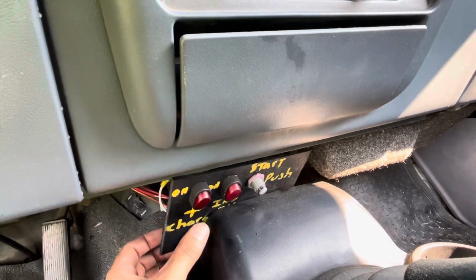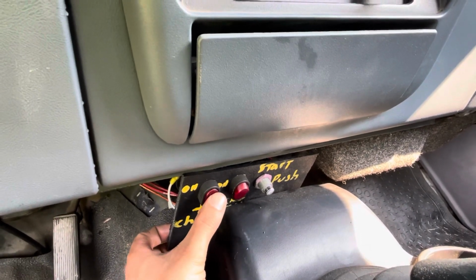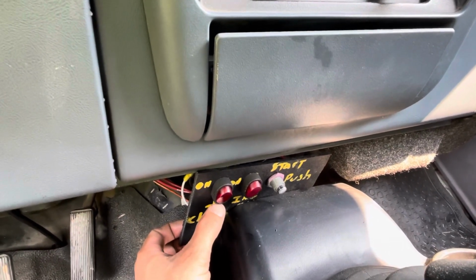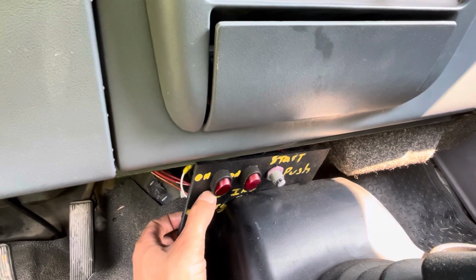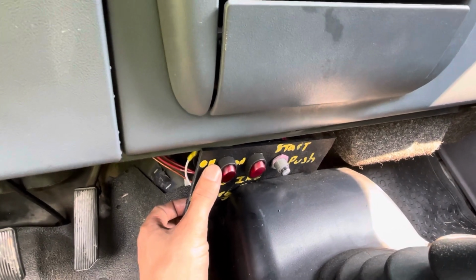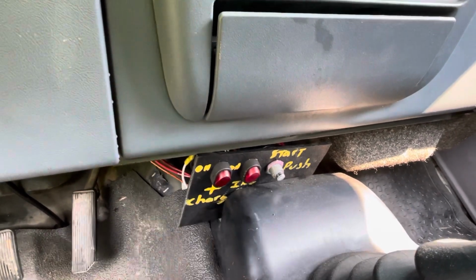easier. And because we do not have the body wiring harness completed yet, this is our charging side. The light does not come on because it's an old switch I had laying around, but it does work. And when it's cold, it produces about 14.4 volts out of the 3rd gen 95 amp Ranger alternator. When it's hot, it's about 13.7, 13.8 volts. At 95 amps, it has more than enough to power this truck.